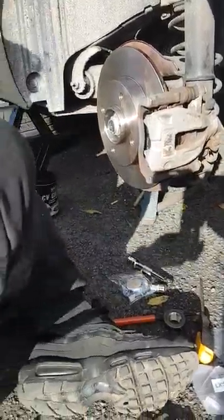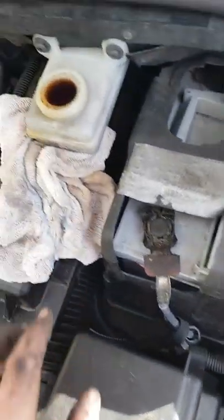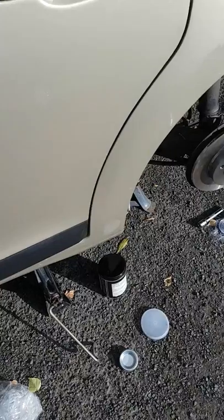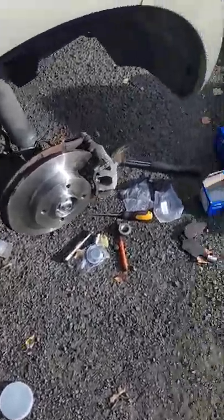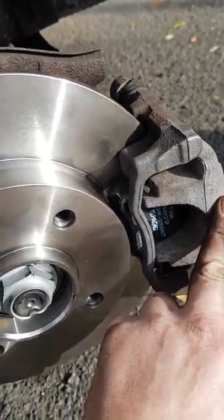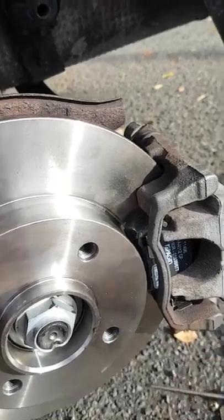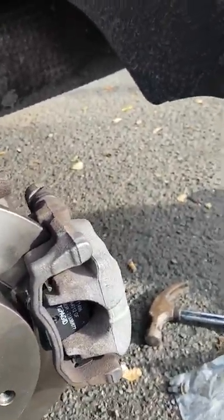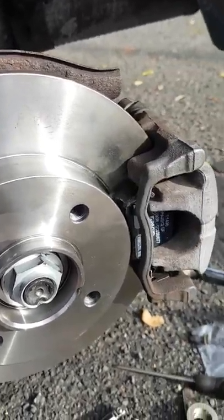I'm going to take a little bit of excess grease out if you've got too much in there. Then pop your wheel back on, jack it down, start up your engine, give the brake pedal a pump a couple of times, jack it back up, just check your wheel's not rubbing or anything. If it is rubbing when you spin it, you'll have to take your caliper back off, rewind your piston, pop it back on, do it again — you might have to do that a couple of times. First time should be fine, and that's how you change your rear discs and pads on a Citroën C4. I hope this video helps somebody.